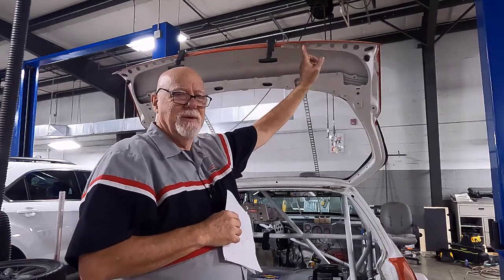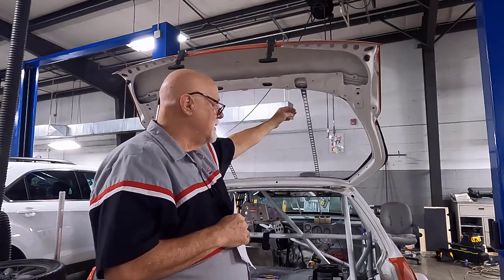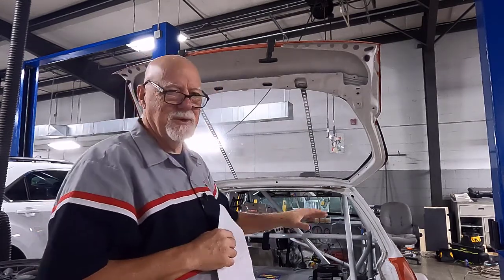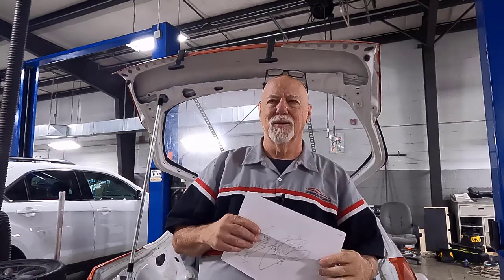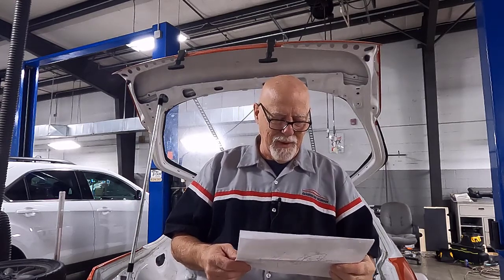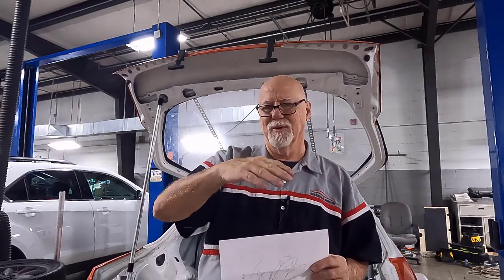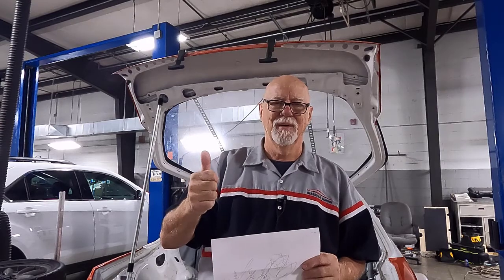You can see on the underside of the trunk deck there are holes drilled all in it. All the trim comes out. These braces to the back window — which is actually plexiglass — have hours and hours of drilling holes in the aluminum strips. Everywhere you look, you'll see things lightened up. Bottom line: if it's not necessary for the function of the car or the safety of the driver, and the rules allow it, it comes out. We're actually several hundred pounds underweight, which is a good thing — because you take weight out of places you don't want it and put it back where you do.